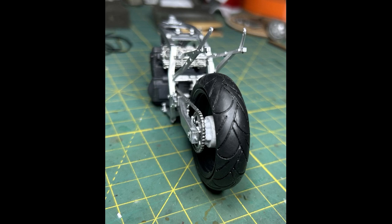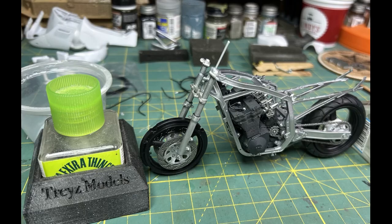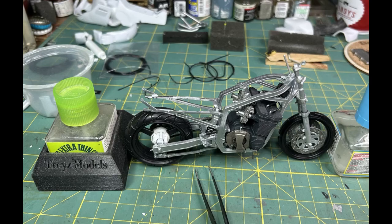With the rims sorted, now it was up to test fitting them, making sure that everything lined up and could properly fit in. One of the main concerns, since it is an actual wider rim, was getting the rear drive sprocket to line up with the front drive sprocket. We did that using a little bit of a spacer on one side to get it to shift over where it needed to be, and trimming off a little bit on the other side. So basically offset it just a hair. It's not noticeable from the back. It was that slight. Lucked out there.